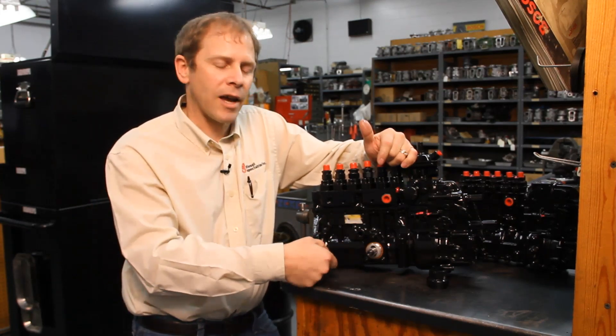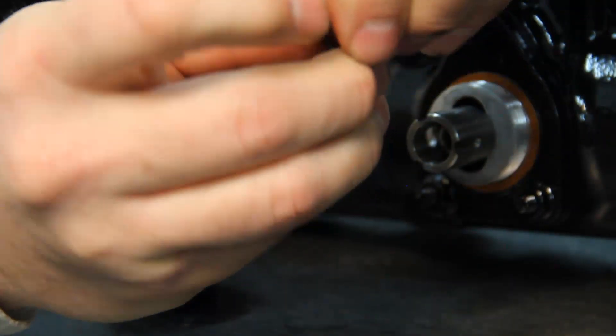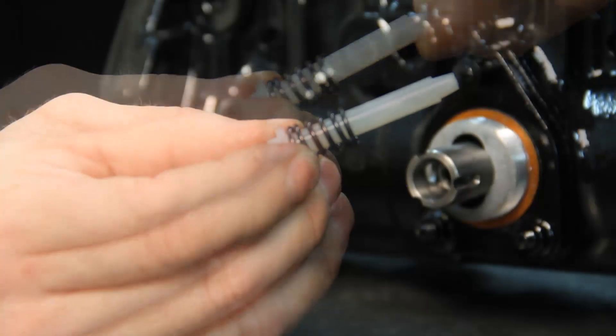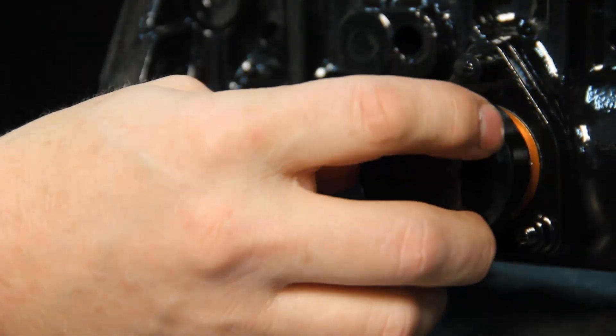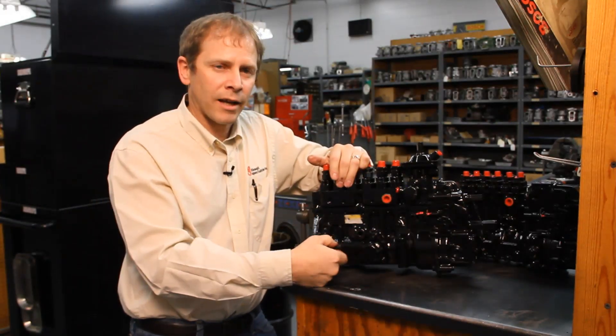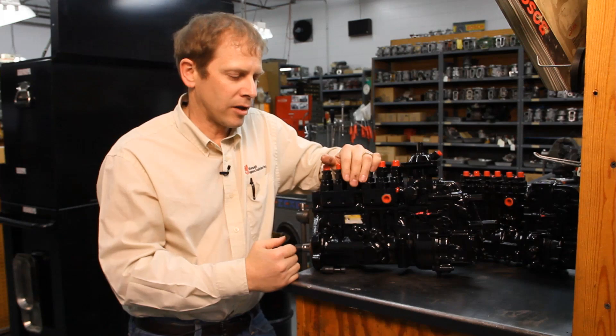We're going to slide this pin back and take this pin out. We're going to put the spring on the run side so that it does not engage any further, then put that pin back in. We're going to put our cap back on, and you've got your engine timing pin pulled back out. Then do your final torque on that front gear and you're ready to go.